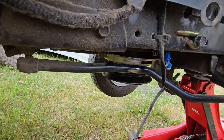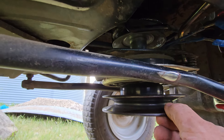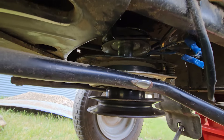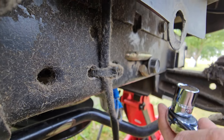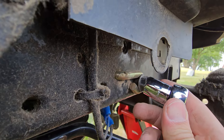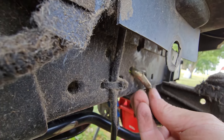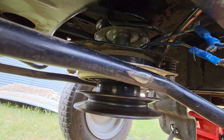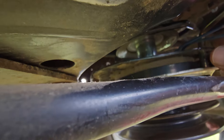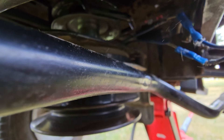There's a little piece in here that holds the belt in place on the deck belt, the deck pulley. We need to pop this bolt off right here, which I'm using a 14 millimeter. That just sits right in the clutch — pull that piece up and pull it through here, get it out of the way.